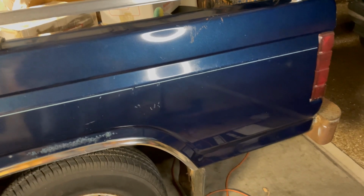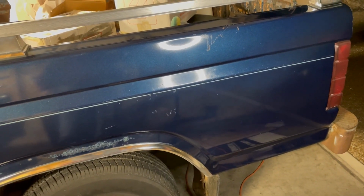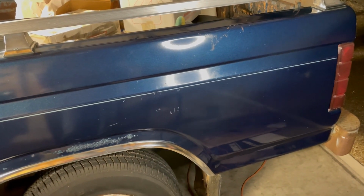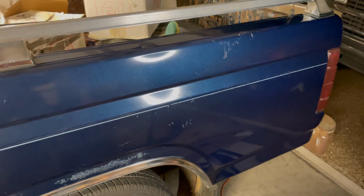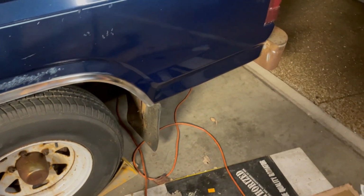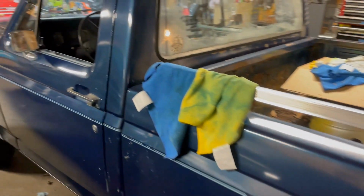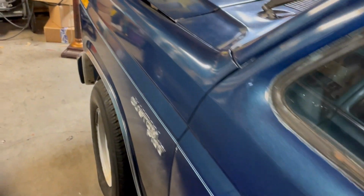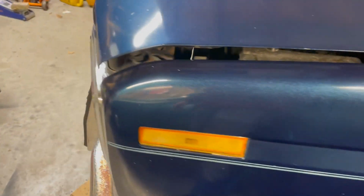But basically, that's how to do it. That's how to cut, buff, and wax your finish to make it like new. Once you're done, if you happen to find a missed spot, just grab the buffing compound and hit it by hand, that one spot, and then wax over that spot, and you're done. And that's about it. That really sums it all up. Again, I'll do a quick walk around, which I love doing because it looks so good.